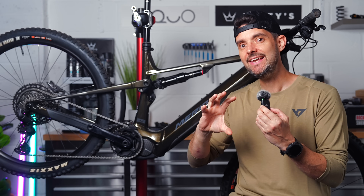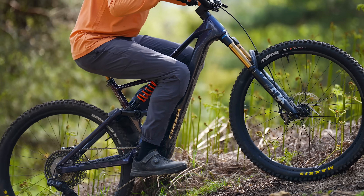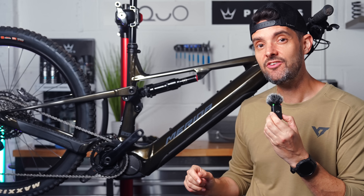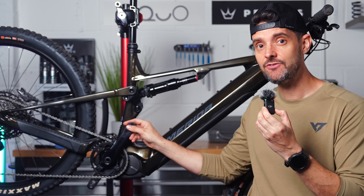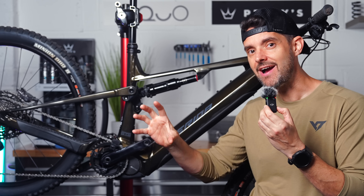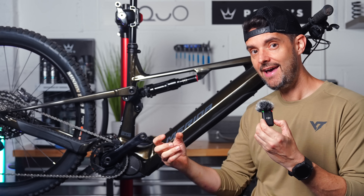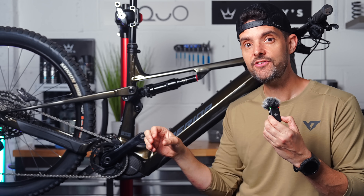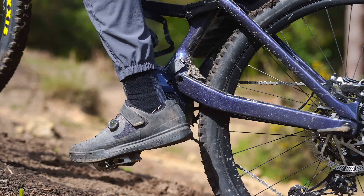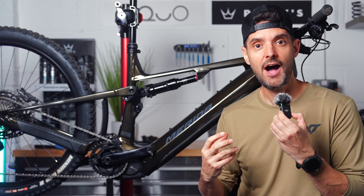Before you had to put through a little bit of a crank turn, maybe a quarter of a crank turn or slightly less, to get the full amount of power from the motor. The other thing the Shimano motor has always been good at is there's virtually no lag on the crank. Some of the other motors have ratchet points with a bit of float between them. So paired with the more aggressive startup and no pedal lag, as soon as you're putting that crank down it's engaging very very quickly. This should be a really strong update.